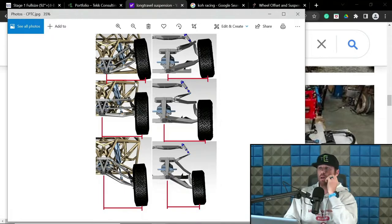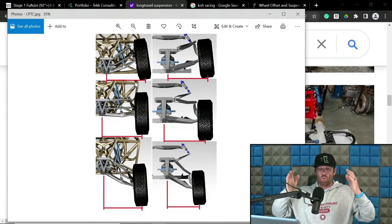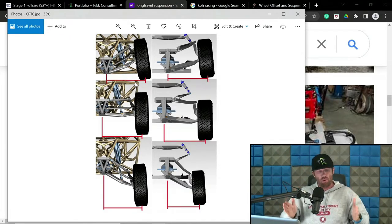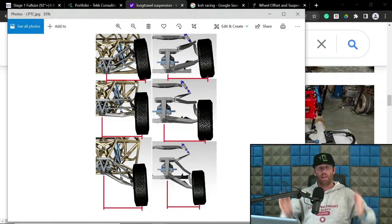So inherently speaking, like I was saying before, any truck that has camber addition at compression, which is almost any truck that you're going to see that's even remotely competitive, is already mitigating it to some degree. How much mitigation you apply is a preference of the builder, the engineer, and the driver. So that contact patch at ride height is going to decrease in size at compression and decrease at extension, because inherently the flow is like that.